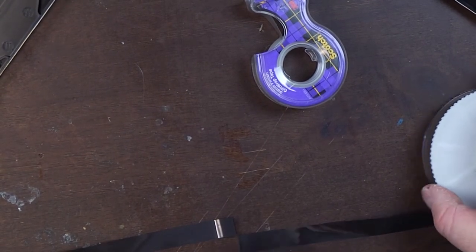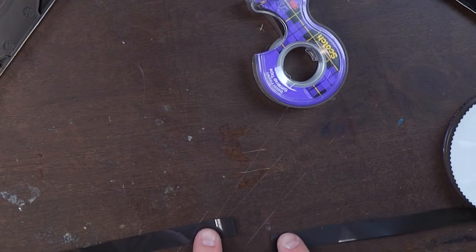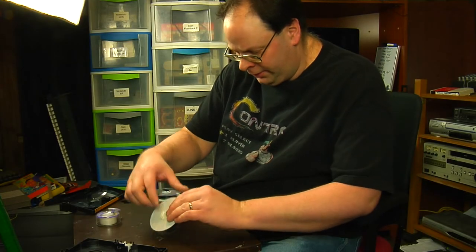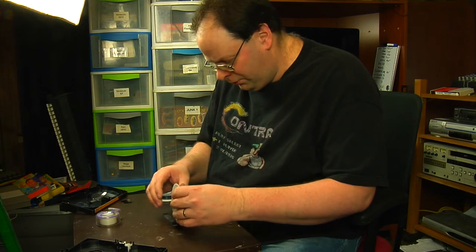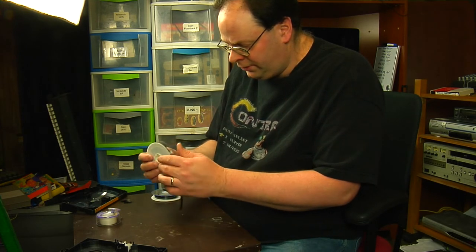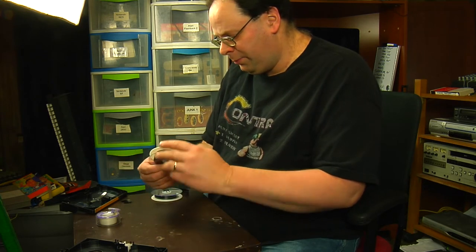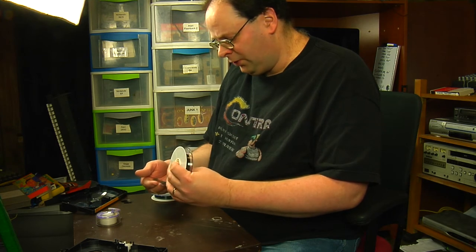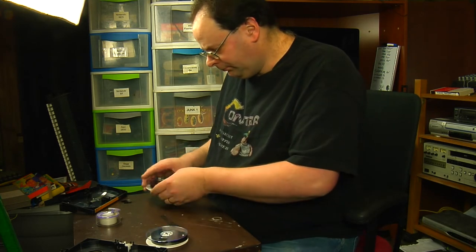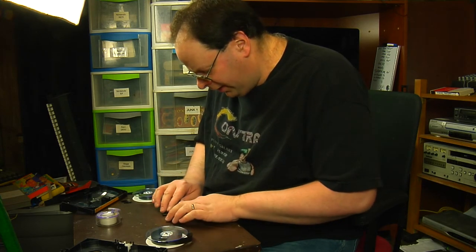You don't want that — you want to make sure that you are on the back side of the tape. The back side won't be as shiny as the playing side, just for reference. The important thing is that this will be running through your machine, and you want to make sure it is not coming in contact with the heads in your VCR. The playing surface is the shiniest surface — that is where your recording actually is. The opposite side is not quite as shiny; depending on the tape stock it may have almost a matte finish look to it. Lay this down on that back side.